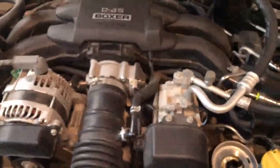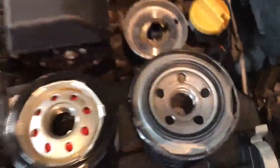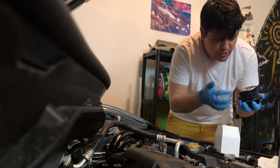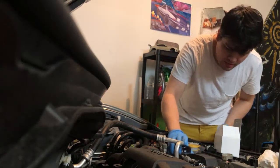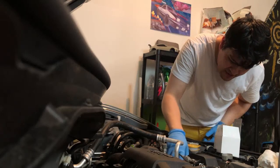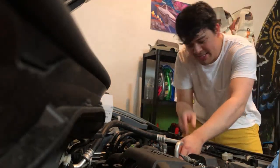I don't know why I didn't look at these in the first place — a simple amendment to my oil change video. If you watch this video afterwards, make sure you get the proper oil filter the first time, and then you won't have to do this and waste your money. I've got a little extra oil from my last oil change that I'm going to use to top off the engine. Before you put that new oil filter on, make sure to add a little bit of oil to that gasket so that it gets a proper fit, gets on there nice and snug, and seals it up tight. Just once or twice around the rim — maybe three times — spread that oil nice and even. Once you're ready, clear the area and make sure that you get that on there hand tight.